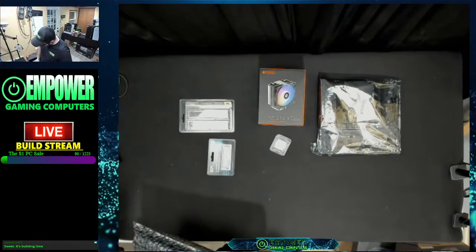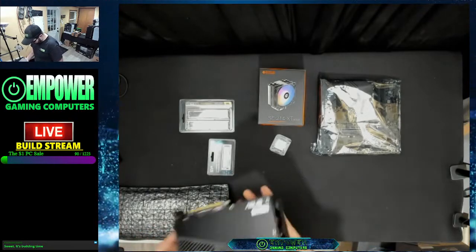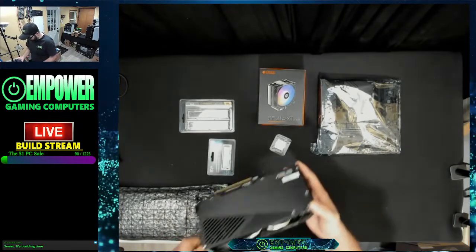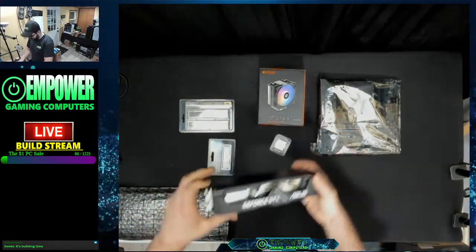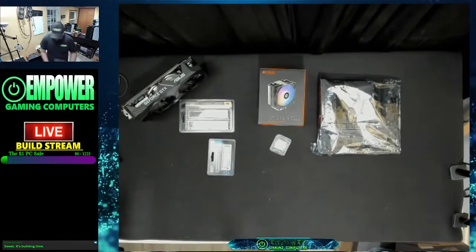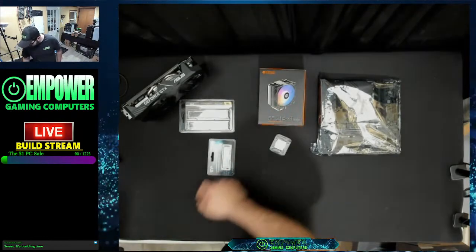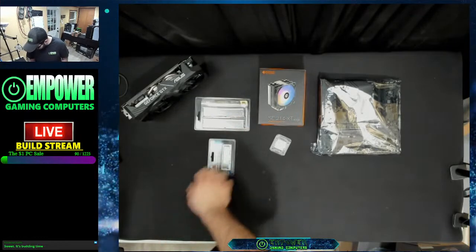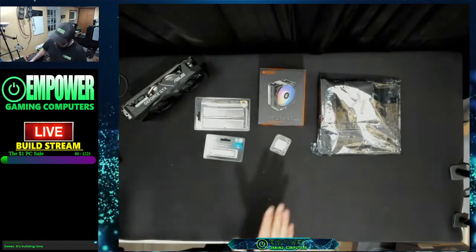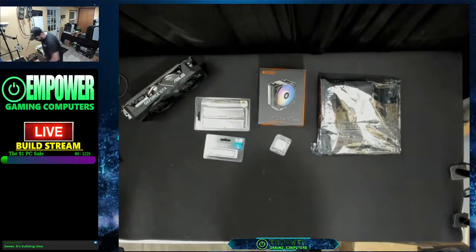So we've got an Asus TUF Gaming motherboard along with that Intel i3. We were able to also grab a GTX 1660, I believe this is the Super, an Evo 6GB graphics card, paired with the Asus TUF Gaming B560 motherboard. This is micro ATX as well. With that ID cooling, 16 gigs of DDR4 3200 MHz RAM and 1 TB of space, he'll pretty much be able to play any game at 1080p with this setup. Not a problem.